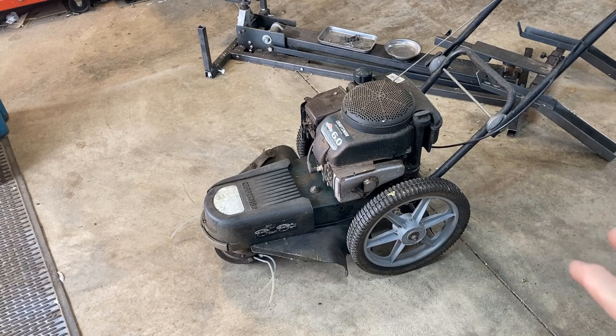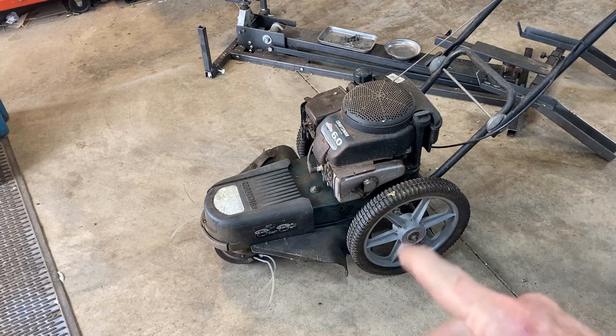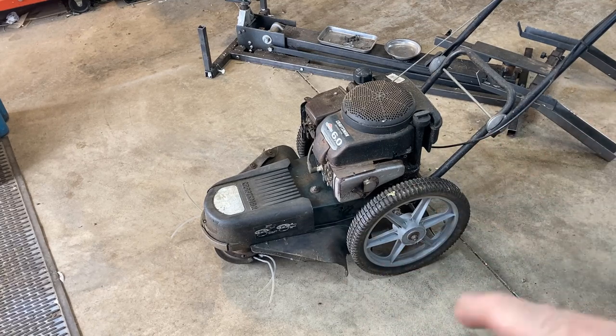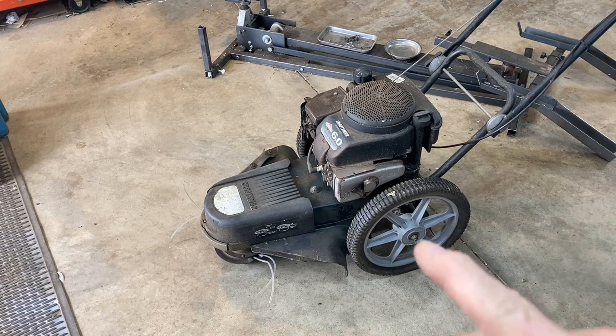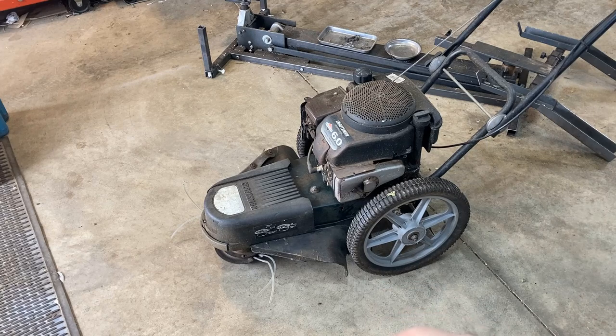So now we're ready to fire this up. A reminder on these — I've had to replace belts before — when it's new, it's tight and the trimmer will actually still spin when you let off on the handle. That goes away quickly; after one use it will stop. When you let off the handle, the trimmer will stop. That belt is not an easy one to locate, so this is the correct belt and I have a link for it in the description below.